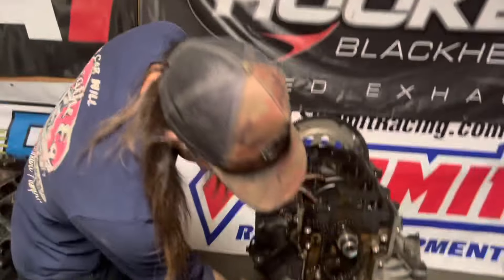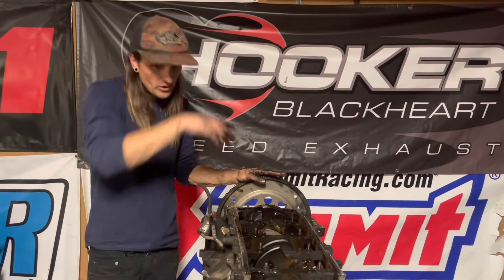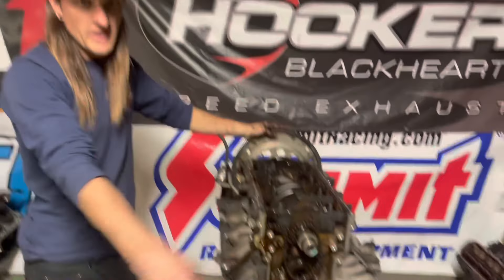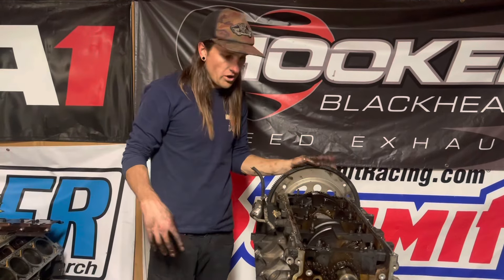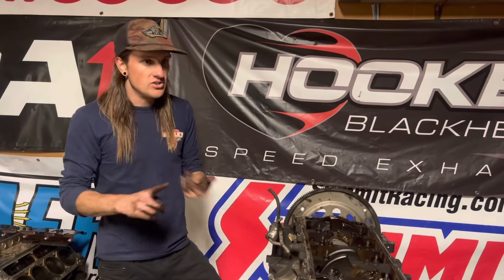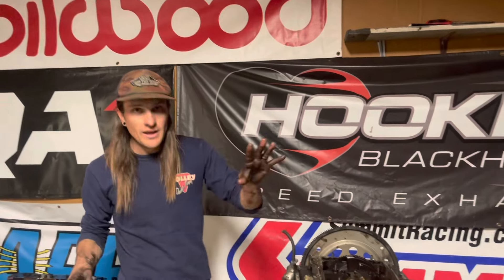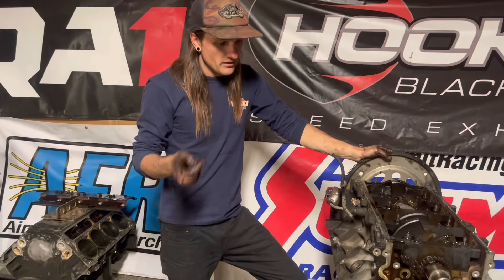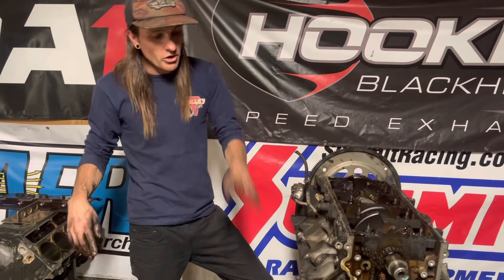Everything that we wouldn't use is gone — the oil pan, cam, lifters, valley plate, all trash. What I really want to do with this engine: those are 243 heads, people want those. I want to use them on an otherwise stock 5.7 or 6.0, or put a set on the Vette. My ultimate plan is to get a set of ported 706 heads for the LH6. The 706 head is the smaller-chamber Gen 3 5.3 head with a 200cc intake runner and 61cc chamber. When you throw that combo on a flat-top 5.3 you make about 10.5:1 compression, whereas this motor makes 10:1 with its 243s and 210cc runner.